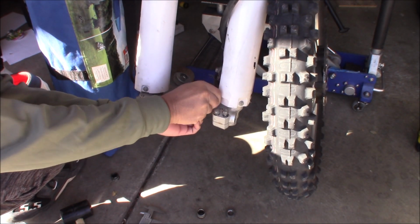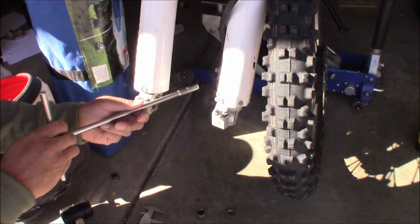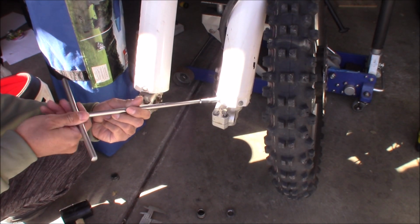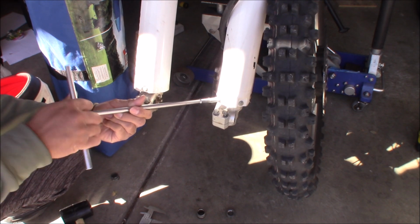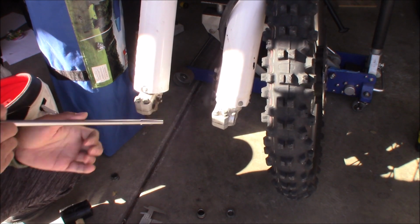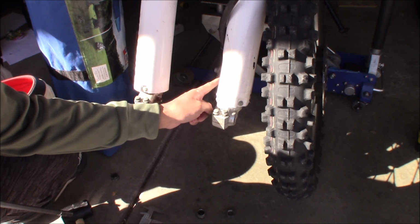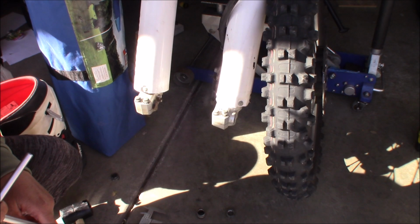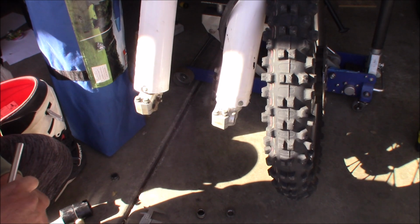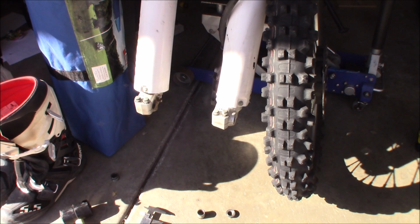Hey, it's blue Loctite, Yamaha Blue. And I've got another discovery here, guys. I think this guy installed the spacers wrong, because I've noticed that the rotor has been rubbing on the brake caliper bracket here. I just measured the wheel spacers. But anyway, let's finish with the task at hand, guys.